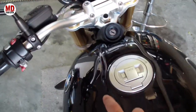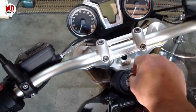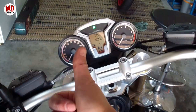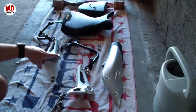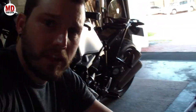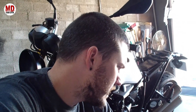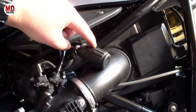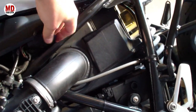Fuel lines are on, plugs are on, everything's correct — let's put in the key and see if we have power. Success! Now it's pretty much the process of working backwards and putting all the parts back on the bike the same way they came off. We'll start with the intake panel, then the decorative side pieces at the back, and then put the seats back on. Make sure everything is nice and tight. Also remember to clip this little thing back into its spot underneath there.